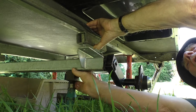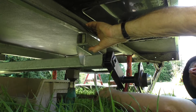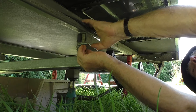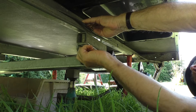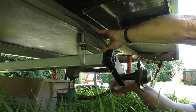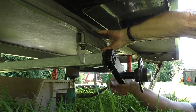With the axle suspended on the one bolt, I am able to line up the second side, get the first bolt through the spacer, and then the hole in the axle. I start to jack up the axle, watching my fingers.